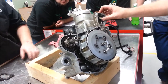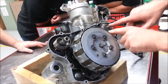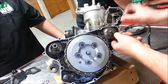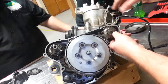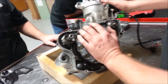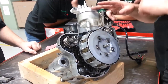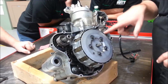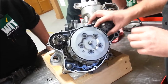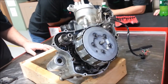Now I'm going to open up the power valve cavity and see if there are any missing pieces in here. With it being a parts bike, there's a chance we might need a lot. Just like our test stand motor, the Suzuki power valve here — when the crankshaft spins, because this is geared by the crankshaft, it's going to accelerate with centrifugal force, move a spring out, which lifts this rod and opens that valve in the exhaust. Faster we go, what did we say about the hole in the exhaust? The bigger it gets. Suzuki tells us to pull the head, pull the cylinder, take the piston off, put a special U-tool on here, and then take off these crank nuts. I like to make these loose now — that gives me the opportunity to use a couple of tools without worrying about the rod banging all over the place. So I'm going to need a 14 millimeter and I'm going to go check out a special tool.